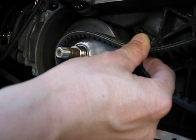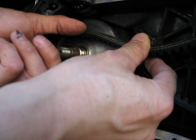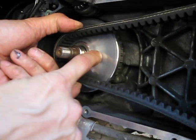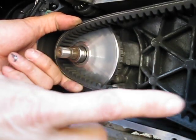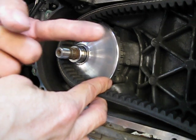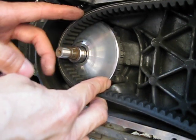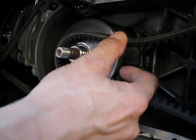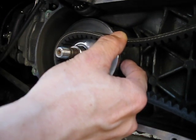The reason for that is since it's geared taller, for a given RPM that the crank spins, your clutch on the backside will actually spin faster — so it engages the clutch sooner. Basically, at a given RPM, the clutch will engage sooner compared to stock.